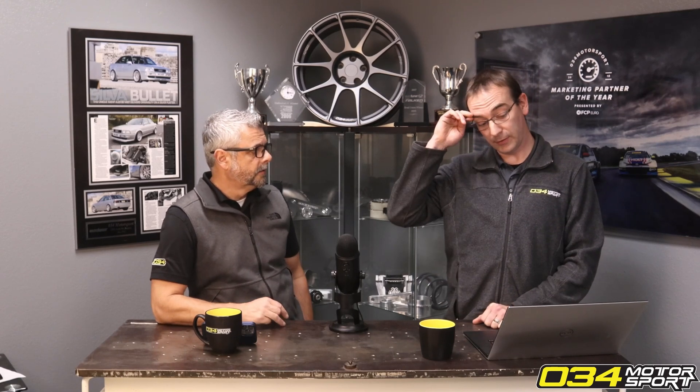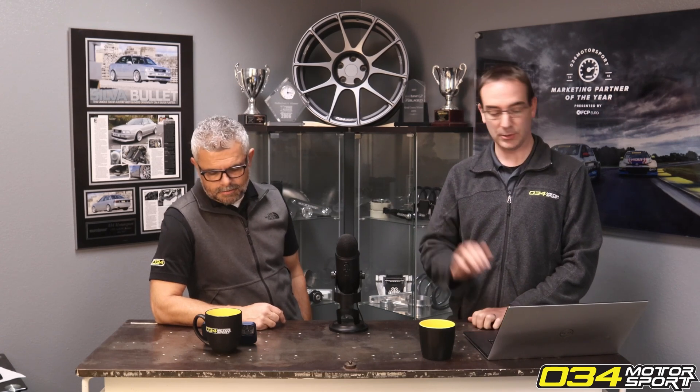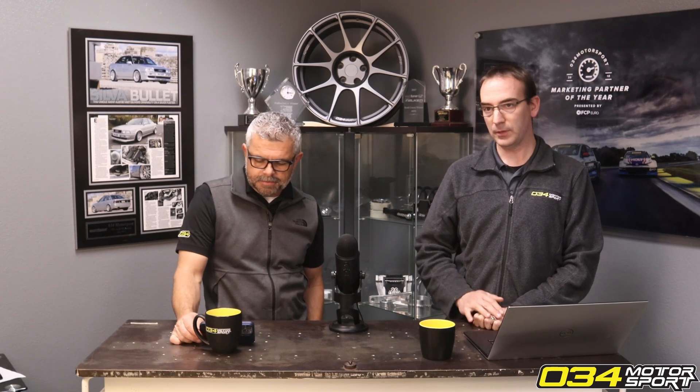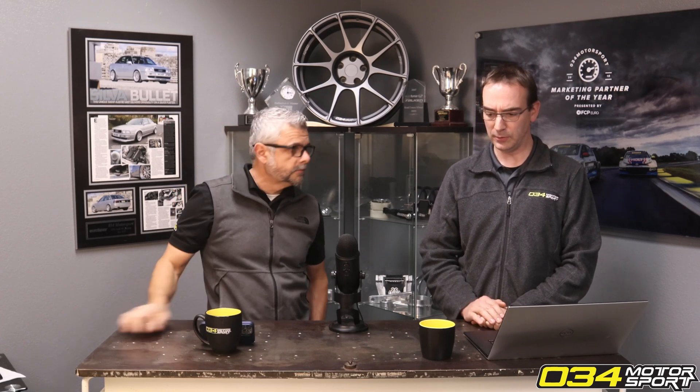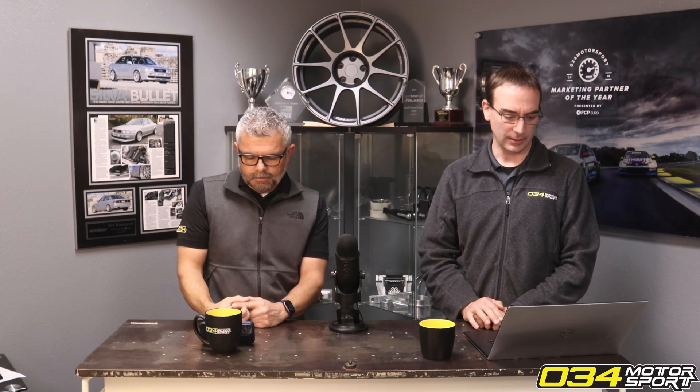The RS7 pump is pretty off. It depends on what you've got for a car. On the B8, you can't just swap any pump because we're talking brush versus brushless. You've got to make sure it's compatible. For the B8, you can do the DW65 and there are a handful of options out there. You've just got to make sure the pump fits into the basket — that's the big thing, you want to make sure you're still utilizing the stock basket.